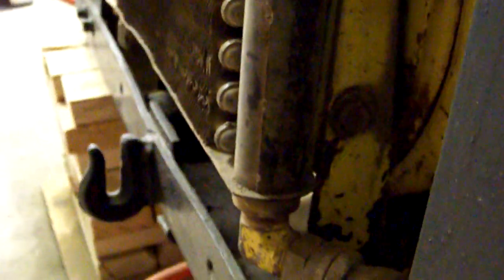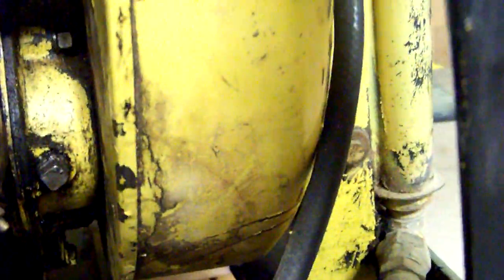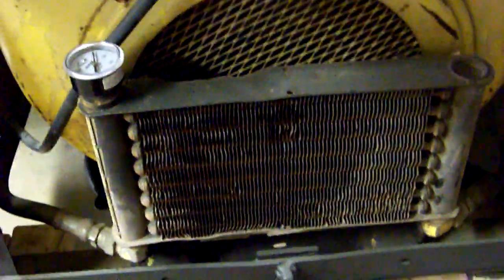So if you decide to replace that line, or do any work on the cooler or the line connecting the oil filter to the cooler, you'll definitely want to purge all of that. I didn't have to replace this line — someone did that previously and it looks good. I did have to move the oil filter back a little and added brackets because I moved the rear manifold back to accommodate some of my longer hoses. Just bear in mind where you may have introduced contaminants and whether they're on the downstream side of the filters.